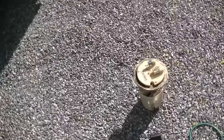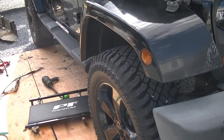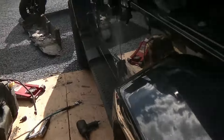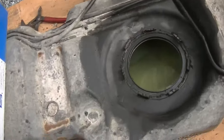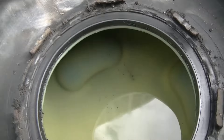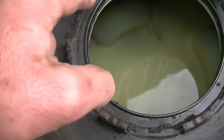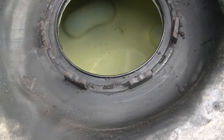So we got our old fuel pump out. The reason we're replacing this fuel pump is because this Jeep has an extended start the first time you start it in the beginning of the day, and if you let it sit for a couple hours it'll do it again. The cause of that is there is a check valve in these fuel pumps that goes bad, allowing the fuel pressure in the fuel rail and lines to drain back into the tank — it essentially loses its prime. I figured if I'm dropping the tank to do the skid plate, it doesn't make sense not to put a pump in it. Now clean this area as best you can and try to prevent debris from falling in the tank — the area where your new packing ring sits is the most important part, so make sure that is spotless.